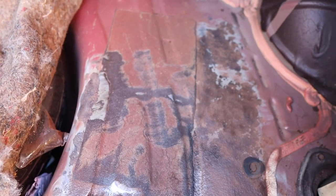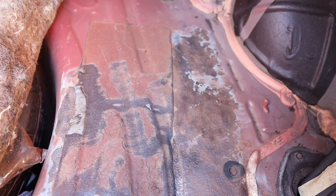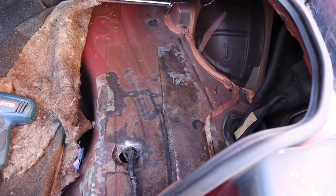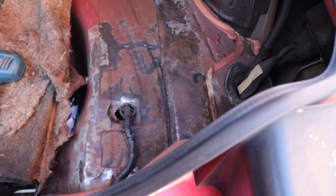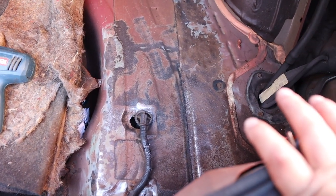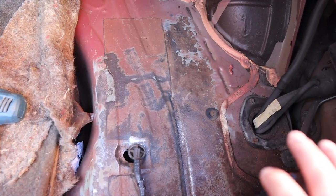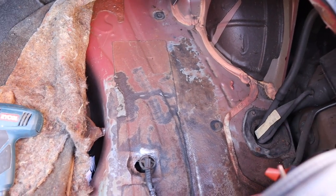I've hit it pretty much almost everywhere. I'm still charging the vacuum so I can vacuum a little bit more. I just got on Amazon and ordered the POR-15, because I want to do half of the trunk — kind of going all around following the curve. I want to do POR-15 even though I'm going to replace that molding, just to make sure none of this gets infected with any more rust. I'm also going to buy the anti-rust primer from Advanced Auto Parts, primer all of this, and then hit it with the POR-15.